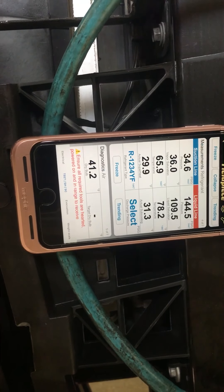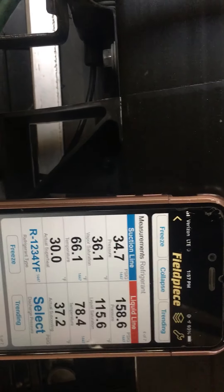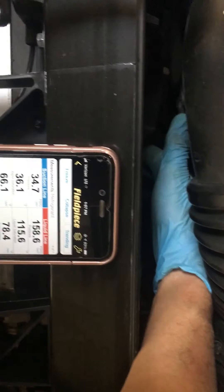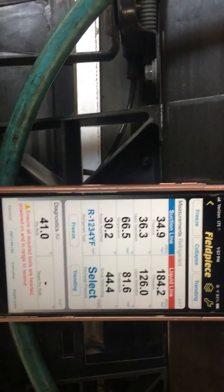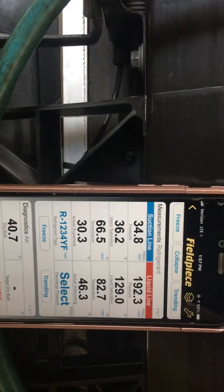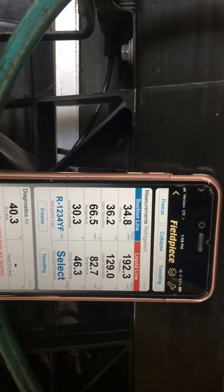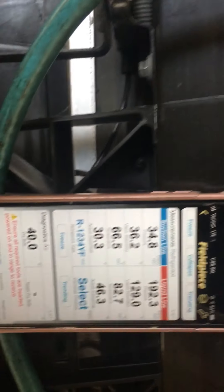That's a pretty steady, constant dash outlet temperature. You can see the cycle right now — there's absolutely no fan. I'm actually touching and moving the fan blade; there's no movement right now. At 190 it'll kick in — there it goes. I'd say about 185 psi — at 185 psi the condenser fan kicked in.